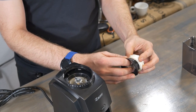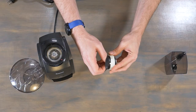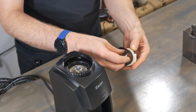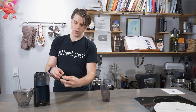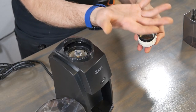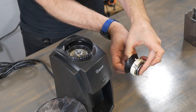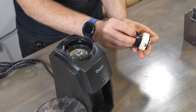These notches slide just over that little plastic wing. What you'll find is you can't just push it down, because if you line up one notch and then just try and push down the other side, it's going to be a little hard to get it to lock down. So here's what we do: take your gasket and push it down as firmly as you can, just snug over that wing. Then, holding it in place with your thumb from your dominant hand, hold this in place, push back a little bit, and use your other hand and thumb to hold that in place. Then, pushing with your fingers, you can sort of place the other edge of the gasket.